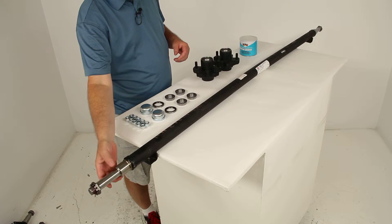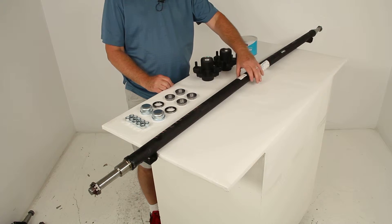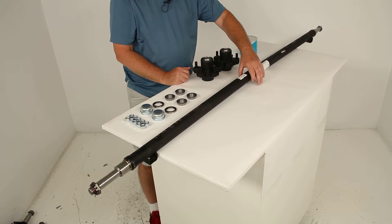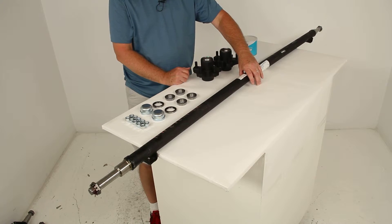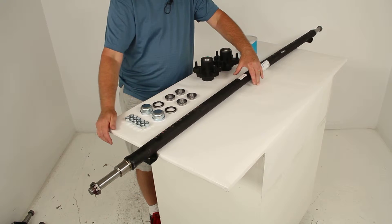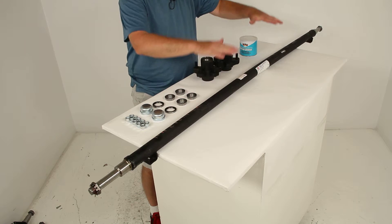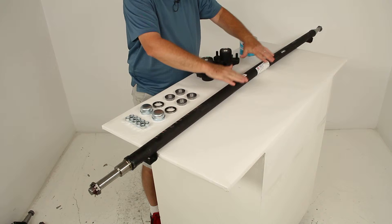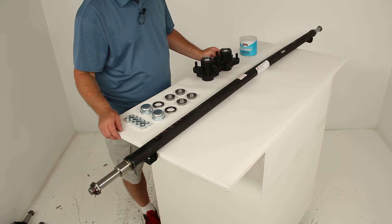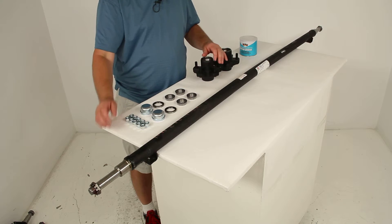The spring seats and spindles are all welded on. Also, all trailer axles will have a bend in the middle — it bends up and then goes back down right at the center of the axle. This helps create a zero camber angle and keeps your wheels and tires for even road-to-tread contact across the width of the tires. When installed and the trailer is loaded, the weight pushes down on the center and evens out the axle, ensuring the correct wheel angle for straight-line acceleration and steady controlled towing.